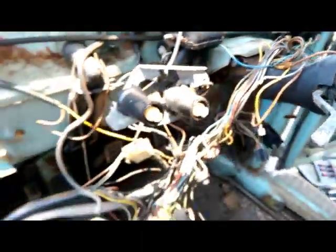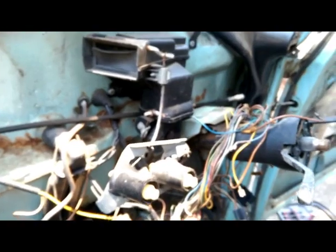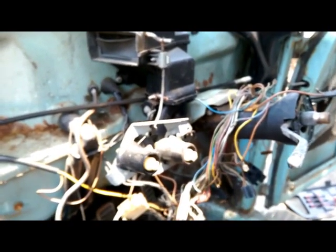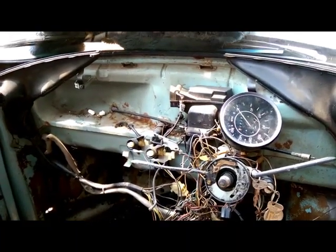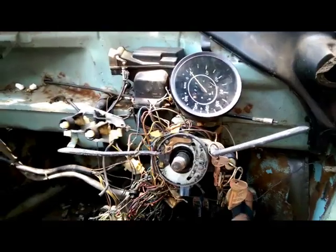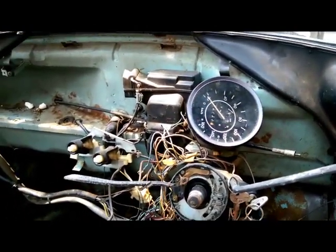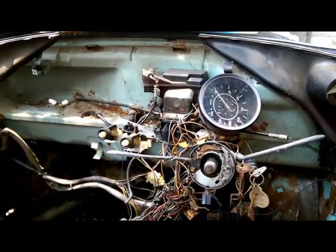It runs all the way up to the headlight switch. Volkswagen had the stupid idea of not fusing all the power wires to switches — only the bulbs — so shorts like that result in melted wires. But I've got spare looms that are in better condition I can use in this car. So I hope people find this useful — you can still run the car like this, I don't recommend it, but the car is still drivable. There obviously are lots of live wires around the place.